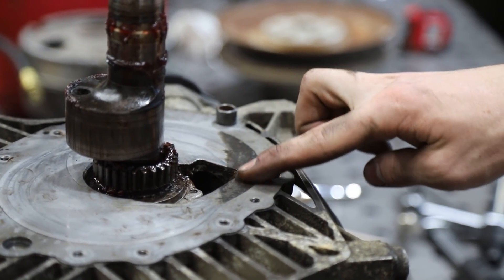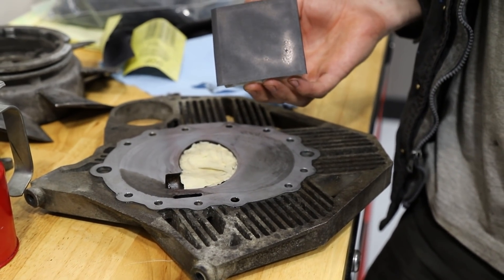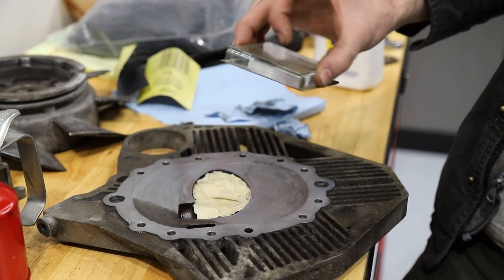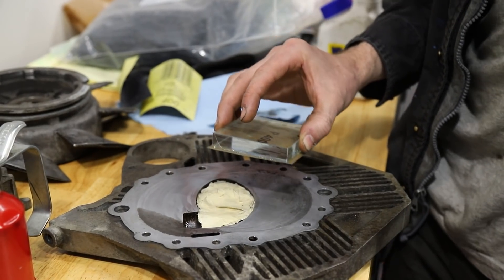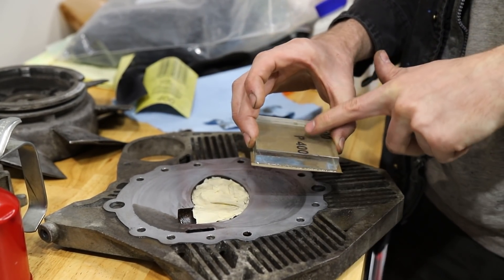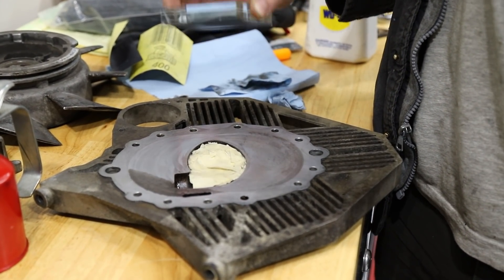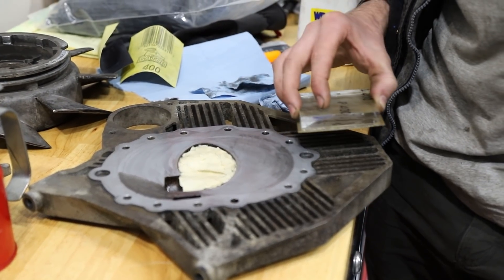There is some deeper pitting and also some raised parts. We're using the same technique from our last rotary build for the rotary shifter cart - it worked great. We're using super fine grit sandpaper, starting at 400 and stepping up to 1000 after the first pass. We glued it with spray adhesive and clamped it down onto a piece of glass for a really flat finish. This is a backyard way to do it, but we just want to see if we can get it running. If there's still super bad pitting we'll have to go to a machine shop.